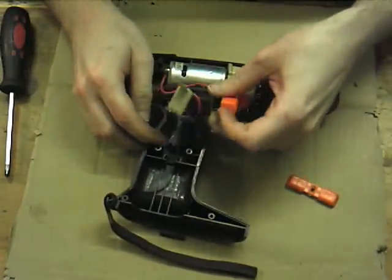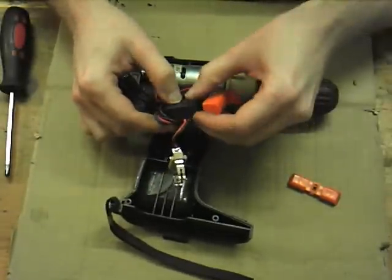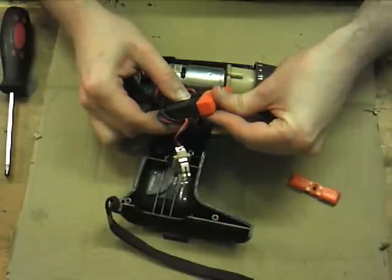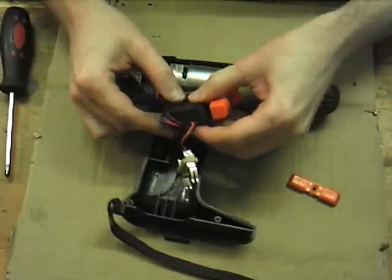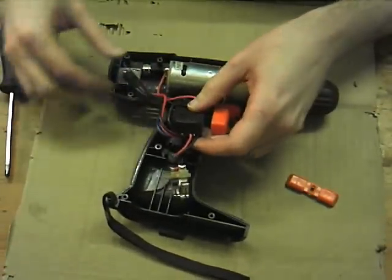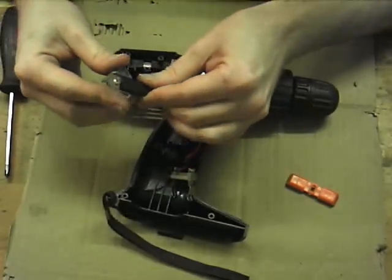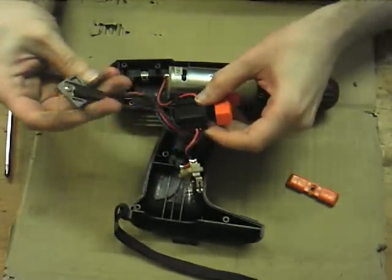So it's simple as that. You've got power going into here. This contains a small pulse width modulation circuit with several positions on a slider switch. And as you press it down, it moves further along and increases the pulse width ratio. That goes out here to a little MOSFET transistor, which dumps the main power.